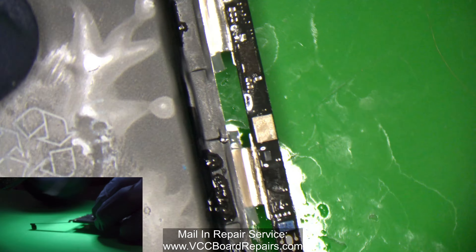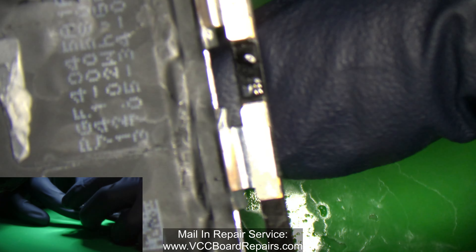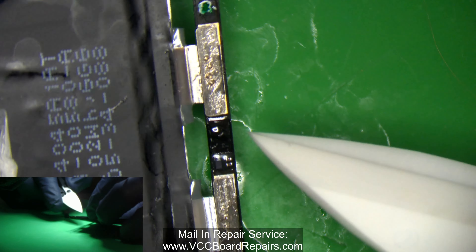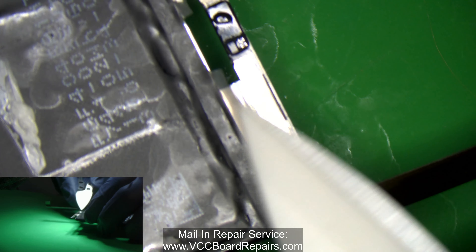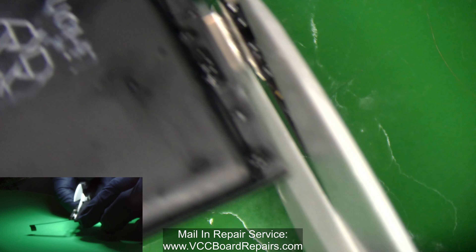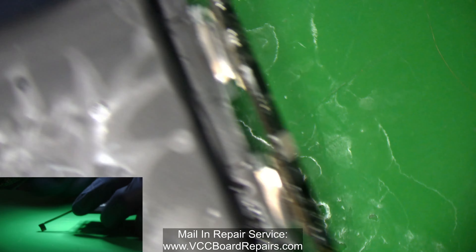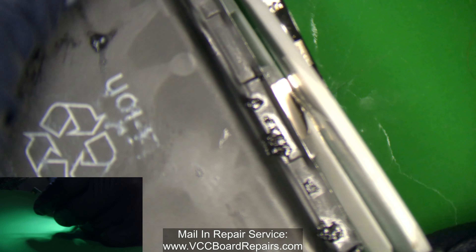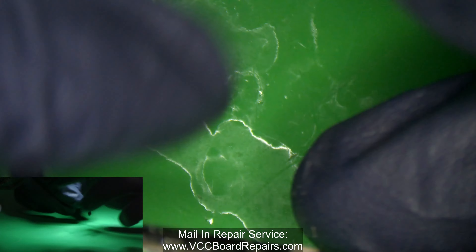One of these connections is positive and one is negative — keep that in mind and don't touch any metal across them, as that's where you can cause a problem. Also be careful not to bend any of this, because if you bend it you could damage the BMS chip. Using the ceramic tweezers, you can see this lead right here — this metal plate — cut across it, flip the battery over, and cut across the other one. That thicker one must be the positive. The original battery we no longer need.